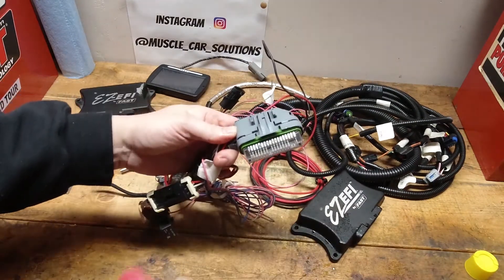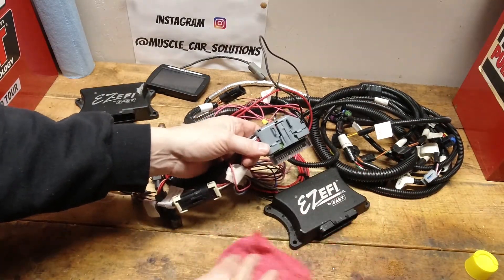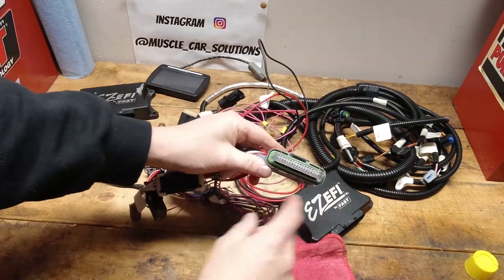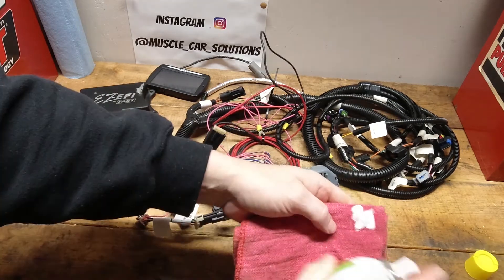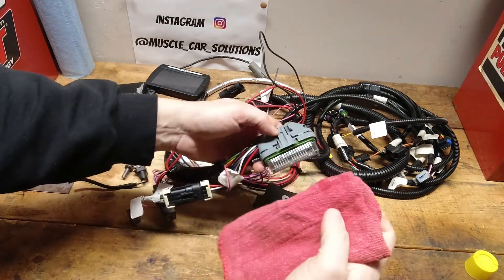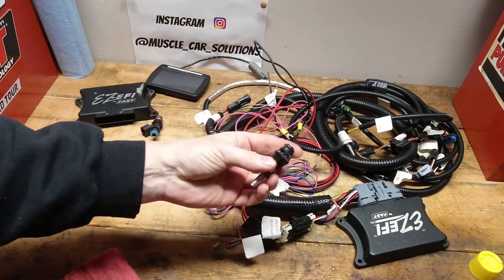On the ECU it's a little more complicated. I definitely would not use any spray — no matter how concentrated or how thin it comes out — directly on this connection. You still have a seal in there, and in this case spray a little on a rag, wipe it on there, and make sure you get it right on the seal so it does not get into the connection at all. That way you avoid any potential problems with it.